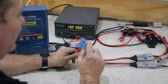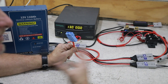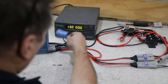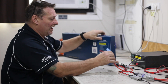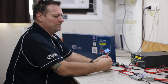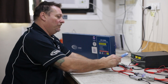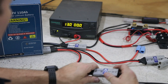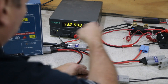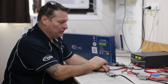You can run the black wire into that as well and run it from the front if you're running twin-core cable — no problem. So you can run your negative and your positive into that. Alternatively, the reason why this one's separate is because I've actually got it going through a shunt, so the negative from the power here is going through into the shunt. Normally you would have an Anderson connection on the blue with the positive and negative going into there — that's input only for your charger.